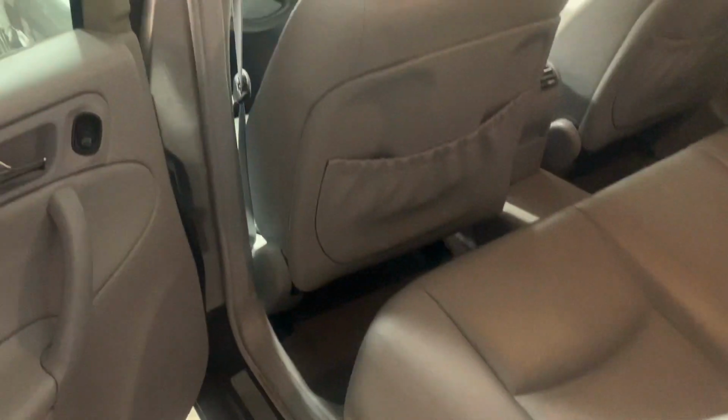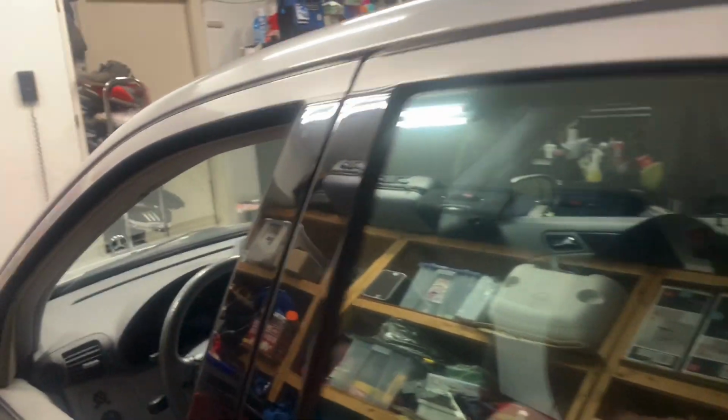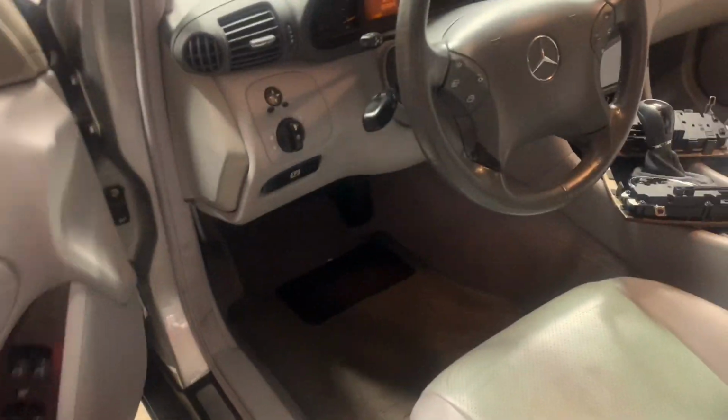And this is not a folding seat, so it's kind of a little difficult. From here I had the zip tie come up. With the electrical tape I attached the wire and pulled it up, and then used a lever to just pull it back a little bit so I can pull it, and then ran it across behind this all the way on the top. Usually I'll run it below, but this one was much easier. And all the way across through here, just peel back like so.